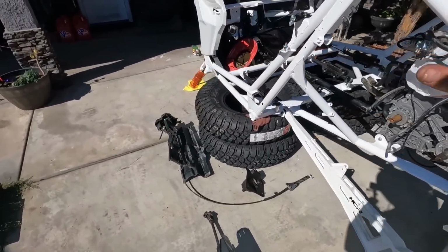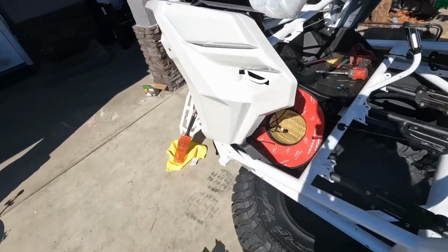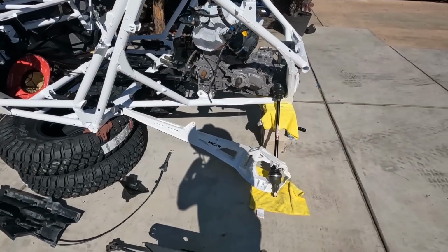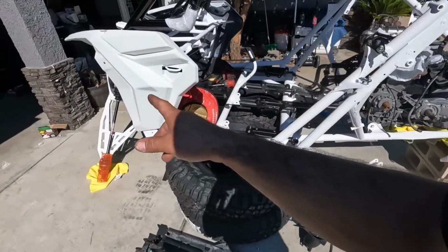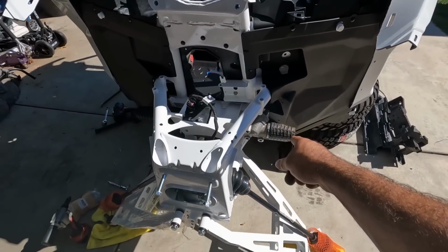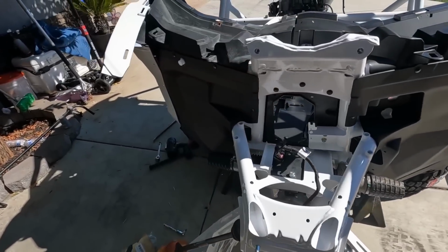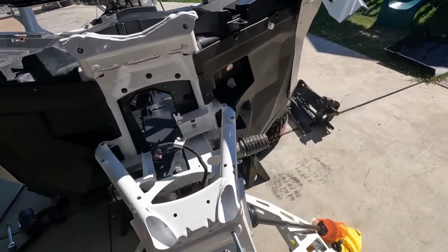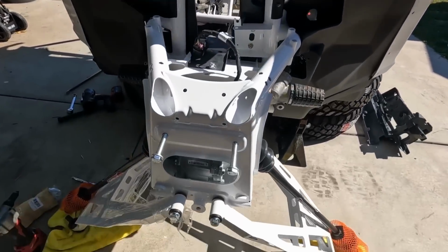And then I'm gonna have to start installing these centerpieces with the shift cable, the cooling lines running to the front, as well as the radiator. At least got to position it over here. Maybe not completely mount it, but at least position it. And then I pulled off the steering column from that machine. The only thing is I got to make sure I'm centered on the current rack before I put the eye shaft onto the rack. So I think this is actually going to come back out because I am doing a steering brace from Black Ops Machine. That's something I gotta install, and I'm not sure if I gotta pull the rack back off, but in the meanwhile I mounted it up with 2 bolts. I do have to go get 3 longer bolts for this side, or just steal them off that machine, but honestly I'd rather just do new bolts. I've been doing new bolts for basically everything.